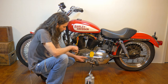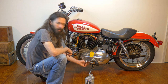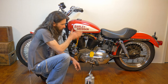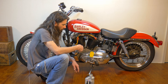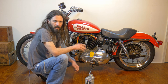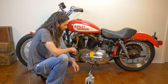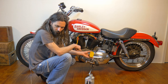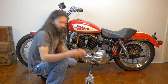Another option is to remove the overflow plug located below the shifter or brake. If the bike is on the center stand, you can just add fluid until it starts to run out of the overflow plug. That's not strictly necessary, but some people like the added assurance of knowing exactly how much fluid is in the primary. After the fluid drains from your funnel, remove the funnel and install your access cover plug.